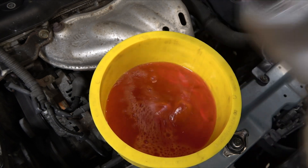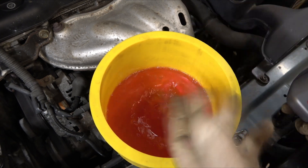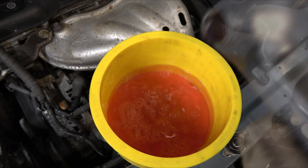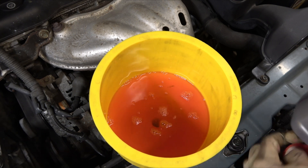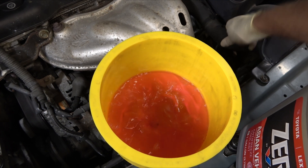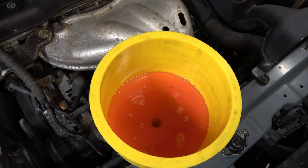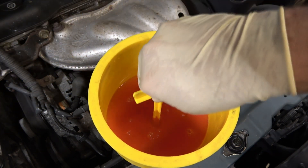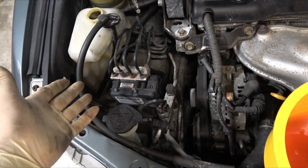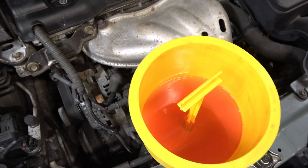It fits a lot of coolant — I'll put about half this bottle in there and you'll see it do its thing. Once the car is running and this stops flowing, you'll see those bubbles pop out and you'll know you're getting the air out of that system. That means it has filled all the cavities it can. If I start squeezing the upper coolant hose, I can get a whole lot more to go in. I can feel the fluid in the upper hose, so I don't think we have too bad of a bubble here. Right now if I wanted to, I can take the plunger, stuff it in here, and when I pull it off I'm going to lose maybe a teaspoon of coolant. Then I can take this and use the leftover to fill the overflow bottle, and if anything's left, I put the plunger back in and fill it back into the bottle of coolant — so no waste, very minimal mess.